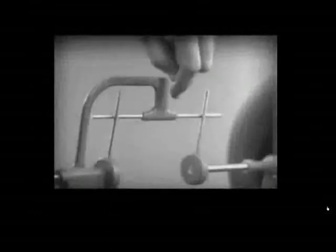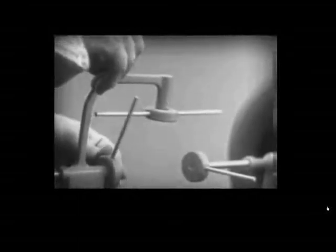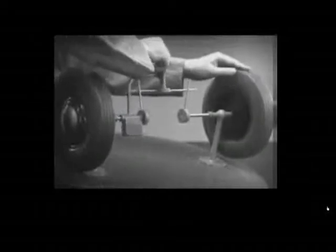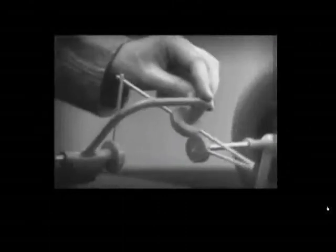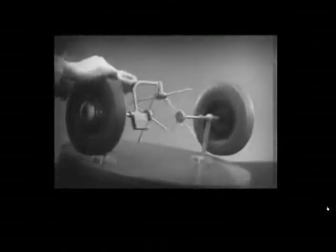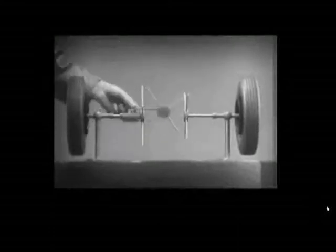Let's put this bar on a pivot so that it can swing in either direction. Now the bar can still turn both wheels at the same speed, and because it pivots, it lets one wheel turn even when the other is stopped. But if turned too far, the bar will swing around until it won't drive the spokes that turn either wheel. We need another cross bar and more spokes to carry on the job. When we stop one wheel, the cross bars will continue to push the spokes of the free wheel around. Now, as long as both wheels are free to turn, the bars do not swing on their pivot and the wheels move at the same speed.